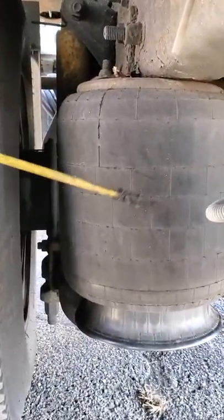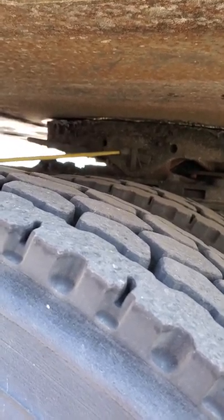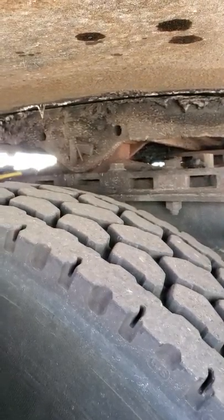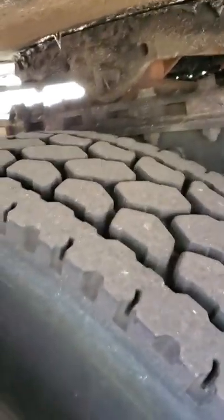Spring airbag mount — top and bottom is secure. Airbag is not cut and it's not leaking. The apron is secure to the trailer. There's no illegal holes, no bulges. There's no space between the fifth wheel and the apron. The fifth wheel is properly greased, secure to the platform, and the bolts and cotter keys are in place. The platform is securely mounted to the tractor frame and all the bolts are tight.